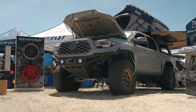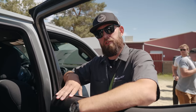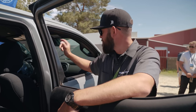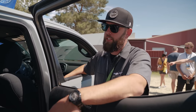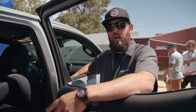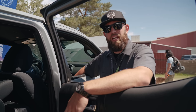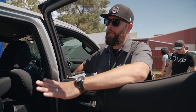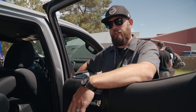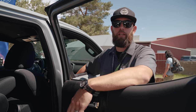The tent is an actual prototype from CVT — a hard shell, super luxurious. For audio, I'm using JL Audio C7 fronts as a three-way: the sixes are in the factory door location, the fours are in the factory dash location, and we built a custom sail panel on our laser at the shop for a three-way up front that looks pretty factory. Behind the seat are two JL Audio 10TW3s in a custom box. All run off the factory Toyota eight-inch head unit with CarPlay and navigation, going into VX series amplifiers fully tuned with the JL Audio Max processor. I urge someone to sit in a car that's been tuned by the Max — it will blow you away.